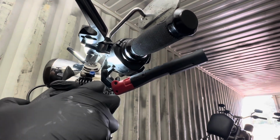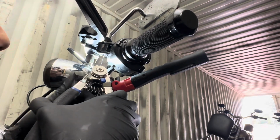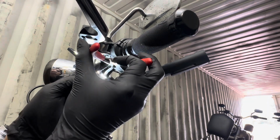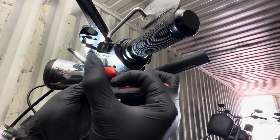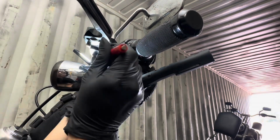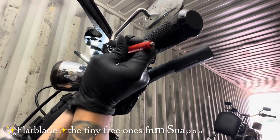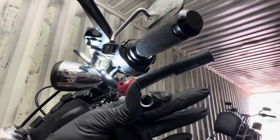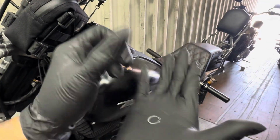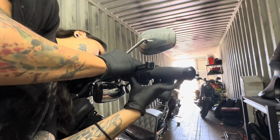Don't sweat it. If it gets stuck like it does for me here, just right over the lip, you're about to get it out, but it doesn't fully undo itself from that little slot. I'm changing the type of pliers I'm using because the angled ones have a much smaller and sharper tip, so it's easier to pull out. If it gets stuck on that wedge, just use a little tiny flathead screwdriver and pry around the corners from one edge to the other, just trying not to mess it up too much. And if you do, it's okay because you can always flatten it back out, and they're pretty cheap if you just want to get a new one.